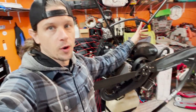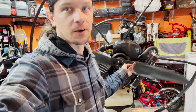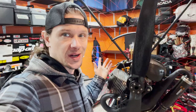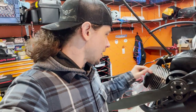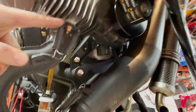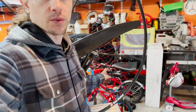Alright guys, so that's about it. Overall, I didn't really find anything major, which says a lot about this motor because, like I said, I've pretty much been neglecting it for the past 50, 60 hours. I took the head off again, the second time I've had the head off. A little bit of carbon buildup, but I was having no issues with it. The spark plug was pretty worn out. That's an easy change though, I should have done that earlier. So I swapped that, cleaned the head, replaced all the nuts for the head and everything like that that I had extra. Replaced the gasket down here. Like I said, I left that bushing in there because it had a ton of life left, but I'm feeling good. I did fix the prop. I've got a whole other video on how to fix propellers though, so I left that out. And I tightened my net, which was loose.